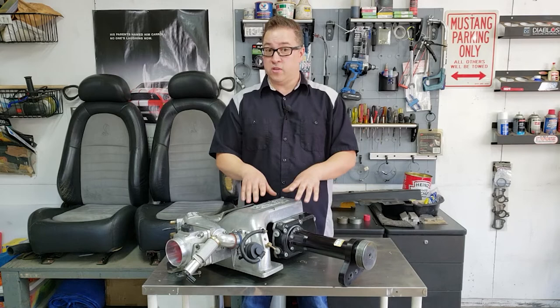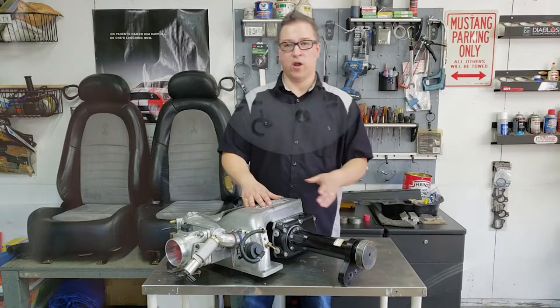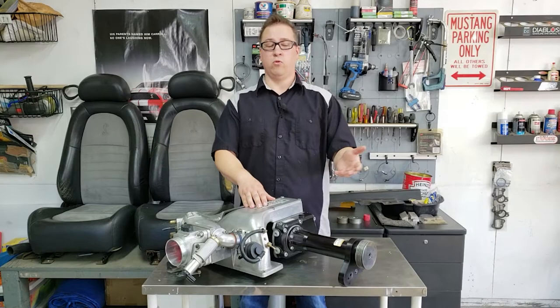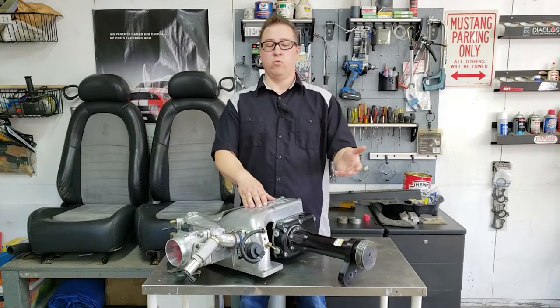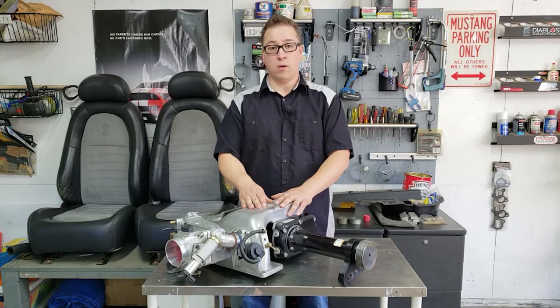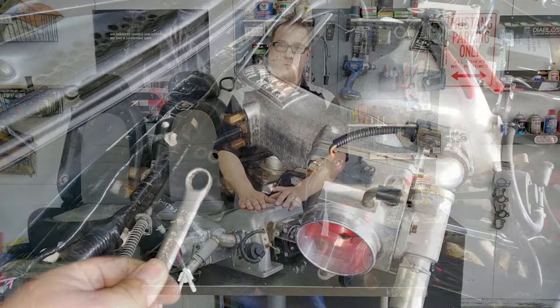There are a couple of spots I had to work around. In the front, I had to adjust my snout support bracket in order for it to interface with the power steering bracket correctly — I had to oblong those holes, not a big deal. A more severe issue was the fact that I had Trick Flow heads. Trick Flow heads have a slightly higher valve cover rail to allow you to clear a roller rocker, with a much smaller valve cover. That valve cover ended up fouling the bottom part of the blower — they couldn't coexist. I couldn't bolt my blower down and have a valve cover in place. You have two options: get a spacer, which puts the blower higher up between the intake manifold and its discharge manifold, but then you have to engineer a spacer for your front support snout bracket. Additionally, in the back, there's the pinch weld where the strut tower brace would mount on a GT. That pinch weld got in the way even without a spacer, so it has to be cut or massaged or hammered out of the way, and it can be pretty inelegant to deal with.